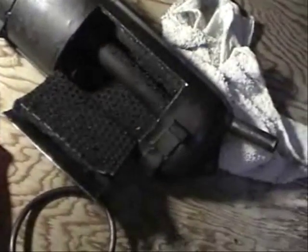This is the fiber insulation that we have inside the muffler. You can see it's kind of dark, stringy. What I need to do at this point is take an X-Acto or any type of razor and cut that away so I can get at the inside. Now this is to absorb the heat and keep it from overheating the metal. Okay, so I've cut through.